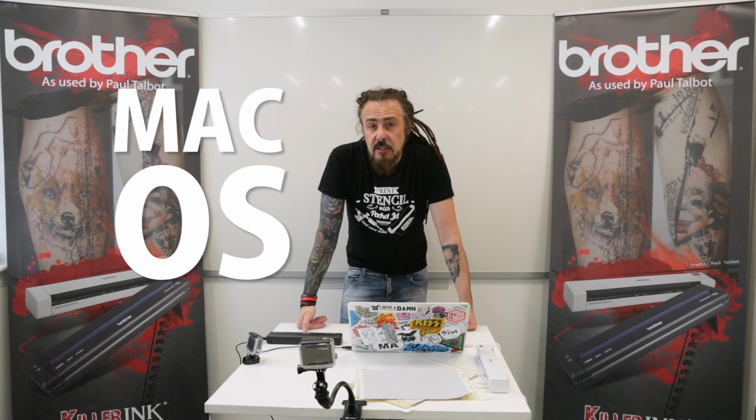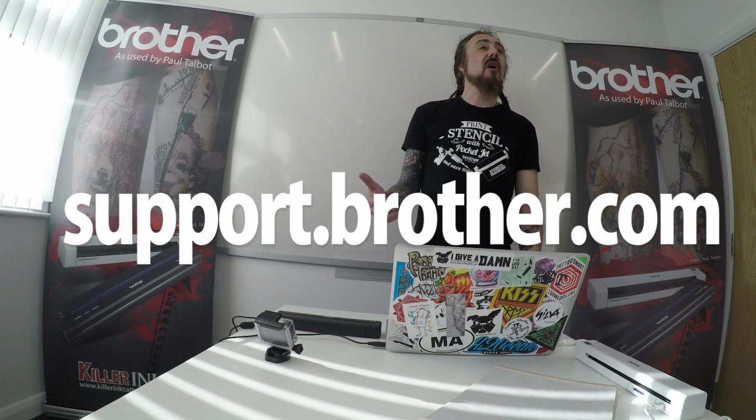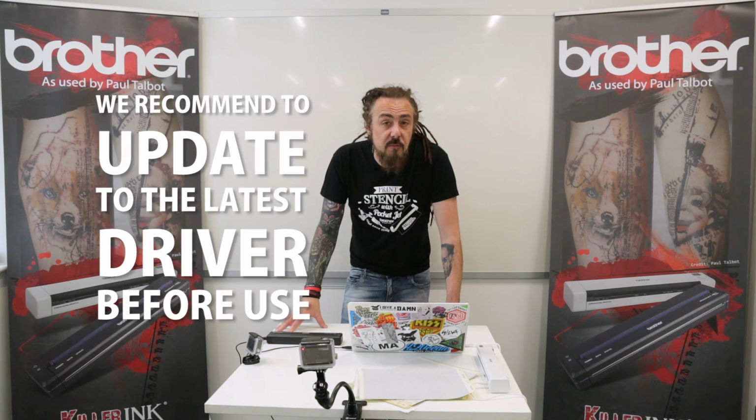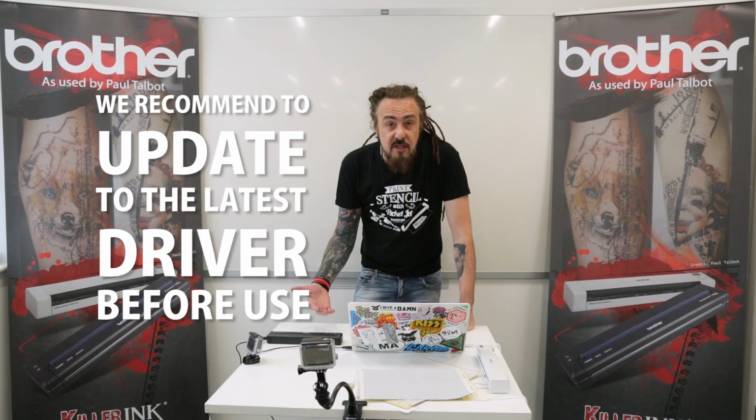Just plug the USB into the USB port of your computer, and at the time that I'm filming this, both the latest Mac operating system and the latest Windows operating system will recognise the printer. If not, go to your local Brother website and download the latest driver software from there. There's a printer utility on the website and your driver software. Your printer is then ready to use.